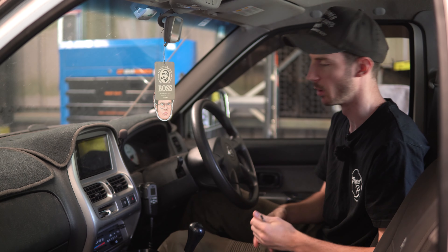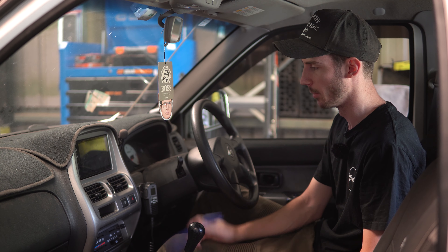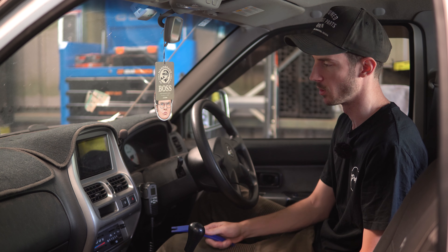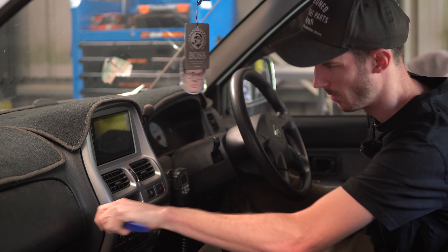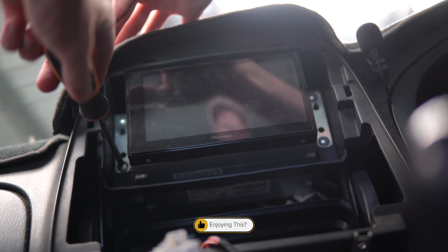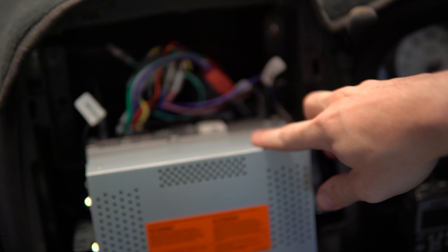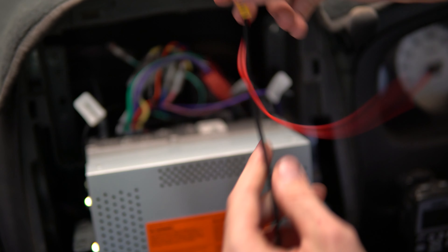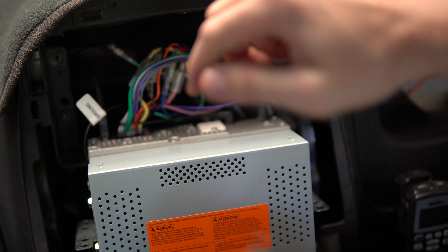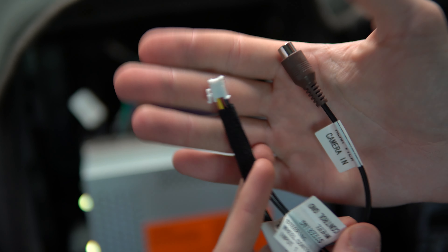On the other side you've got the other RCA connector and also the red wire — still the same 12-volt reverse signal. Then there's a connector where the RCA plugs in, and these two wires — red and black — just have to wire to a constant power and ground, so an ignition positive and negative. Then you come through to this plug which connects to the camera side. That plug just connects here, with a bit more wiring to trace as far as you want, and then you've got the camera to mount somewhere. That's how the wiring for this one works.